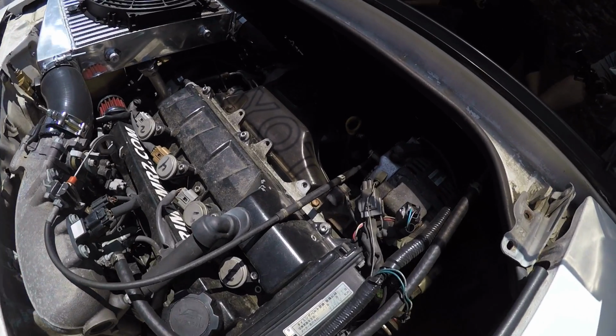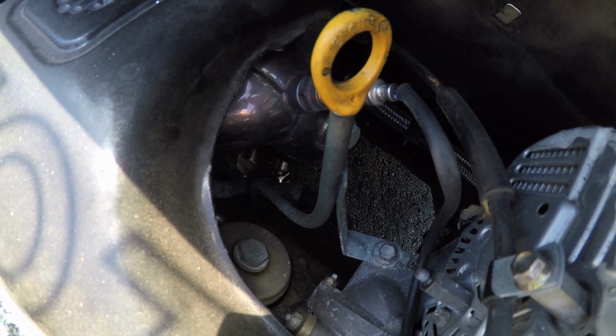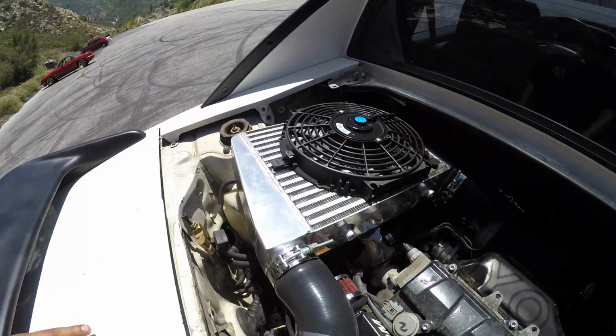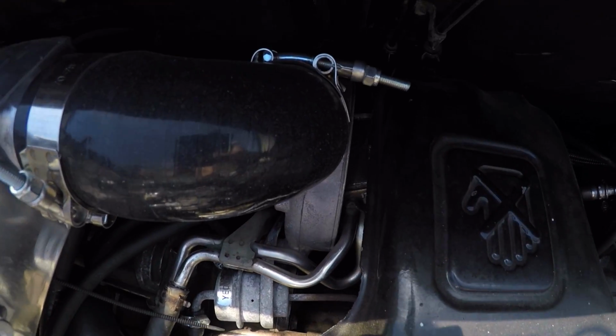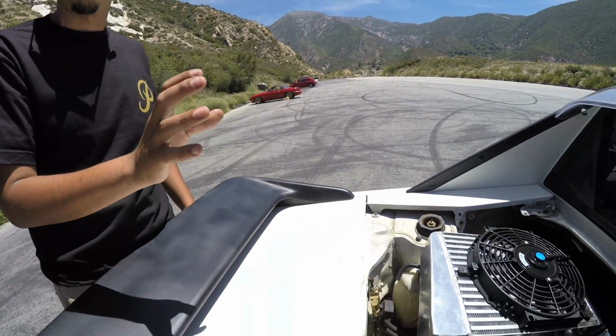And you were telling me that this turbo, I don't know if you guys can see, but he was telling me that the manifold for the turbo are both like one piece. Yeah, Toyota doing the stuff they always do. They decided first, second, and third generation motors of these, you can actually remove the turbo from the exhaust manifold. So if you want to do an upgrade, all you have to do is purchase aftermarket turbo. For this one, the exhaust manifold is cast into the turbo, so it's all one piece.